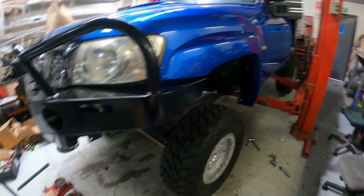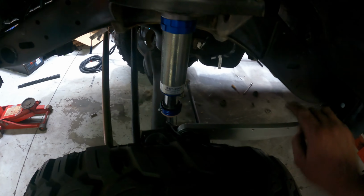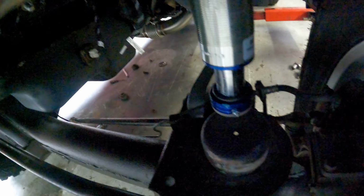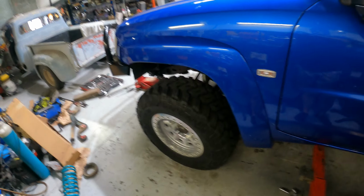Bloody big rig here. But here it is, what I'm showing you guys is why I've put these arms in first before I set these. At the moment, if I look directly down, as you can see, it's meant to be over here. But when I lower this, it's not actually on the plate. It's right on the edge when I'm at bump. So I've got to cut this off, angle it a bit more, and get it realistically to the center. Anyway, I'm gonna go ahead and cut this all off and go from there.